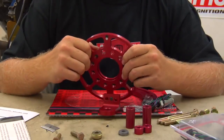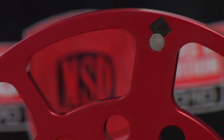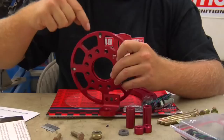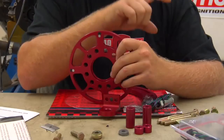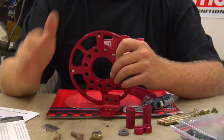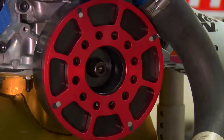The special thing is that only these rare earth magnets can trigger the ignition system. There are several others on the market that either use a steel wheel with dimples in them or an aluminum wheel with steel inserts and then utilize a magnetic pickup. These units are very susceptible to false triggering. False triggering is bad. An MSD flying magnet crank trigger will not false trigger — it's simply the most accurate way to trigger an ignition system.